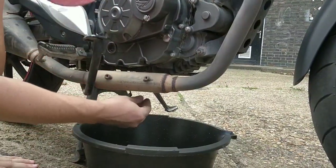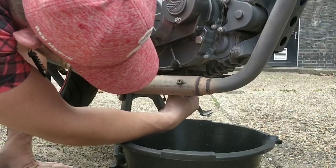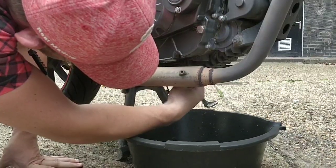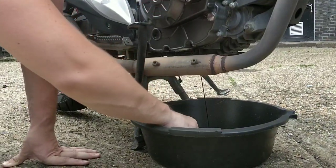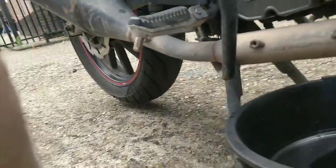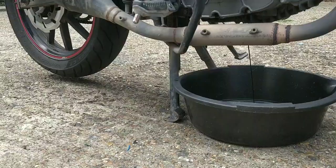That's running well. Come on then, we'll drop the oil. So I have made Gary aware that the exhaust is obviously hot and the oil will be a little bit hot, but not loads. We're dropping the oil. We're looking for colour, consistency. Is it contaminated? Don't burn your hand. There you go. Lack of flow, maybe. That's interesting. It's not very flowy, is it? Let's pop the lid up here. Very, very low amount of oil in there, guys. Shocking, actually.